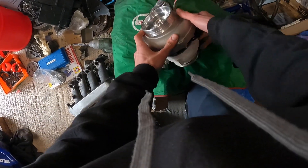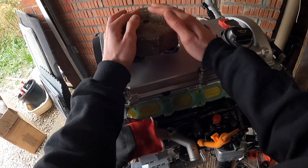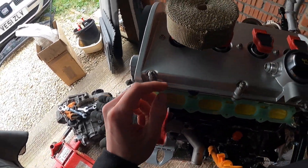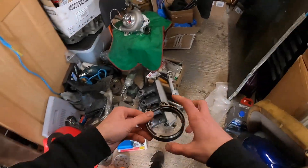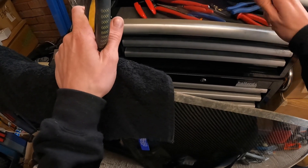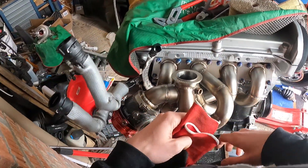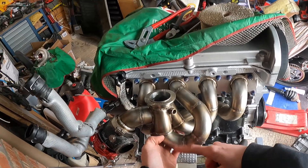Right, let's go back to the exhaust wrap. So we need a couple of things to do this. I've got some gloves - make sure you wear some gloves. This stuff isn't as bad as other people's. We want some snips. Definitely want to be wearing some gloves. We've got to try and plan out our routine of what we're going to do. The most important bit that I'm concerned about with heat is this collector here - the collector and this long runner here, because this is where most of the heat is going to come off for the actual drain.